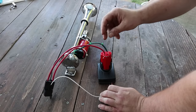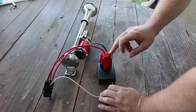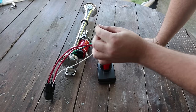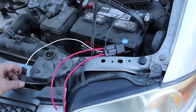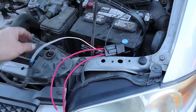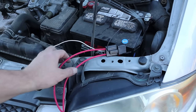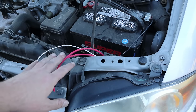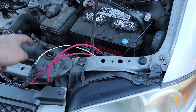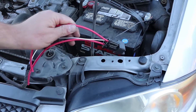This is basically how it's going to work inside the car — this red wire hooks directly to the positive terminal on the battery, and the grounds hook anywhere to ground, which we'll go over in a minute. The signal wire that energizes the relay comes directly from your horn — I just unplugged the wire that was going to the factory horn, which is the hot wire when you push your horn button. The other side of the relay goes to the negative post on your battery. This is just for proof of concept so you can see the relay working before we hook up full power. Sounds like it's working fine — now it's just time to make it happen.